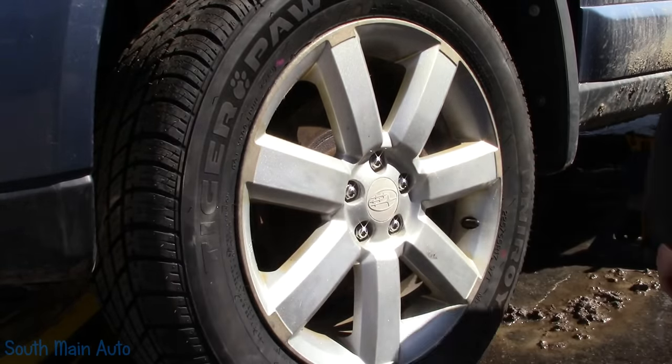So I went ahead and cleaned out this bracket too. We'll lube this up. I see the pins are free. Like I said, the brake pads are better than half worn out, but we'll reuse them. He doesn't want to put a ton of money into this thing, so yeah. Let's see if I can clean out up inside the ball joint hole here. Get some emery cloth. Shiny. Looks good.